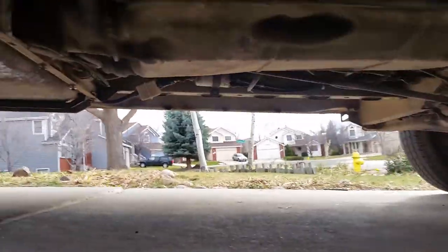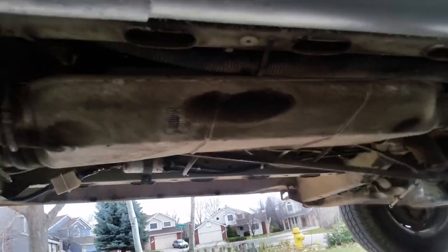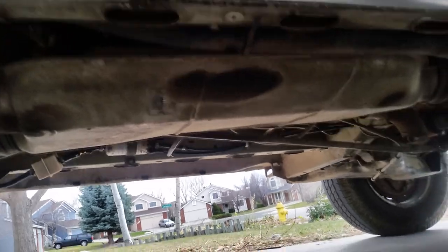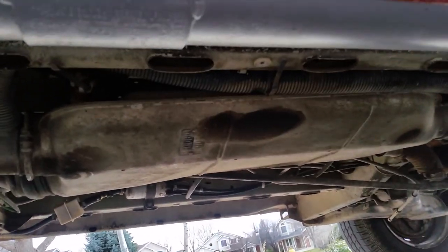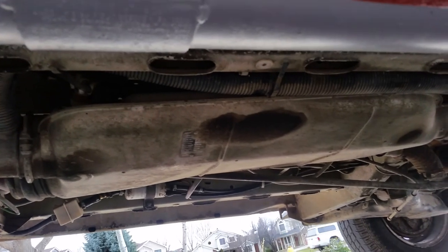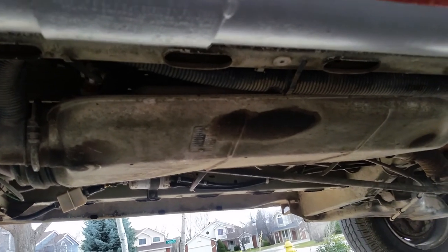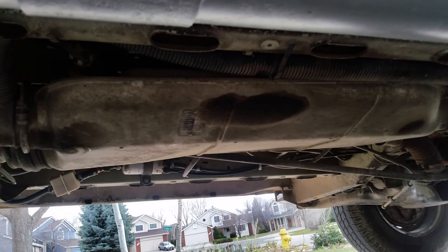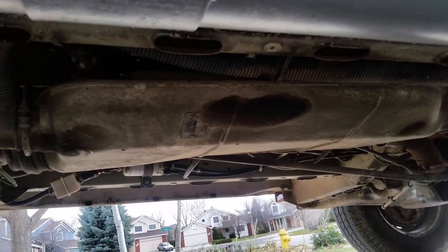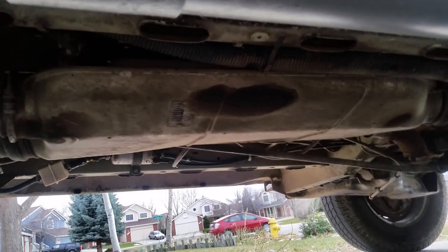Underneath the van, this right here is the gas heater. It takes gasoline from the tank and there's a combustion chamber inside of there, and that's a heater, much like you'd have a heater in your home for the coach portion. The reason that I've unhooked that is because there's plenty of stories online where people have been running one of these. One of the safety switches failed and it heated up too much and burned down the van, and people have died from that. So that's just unhooked.